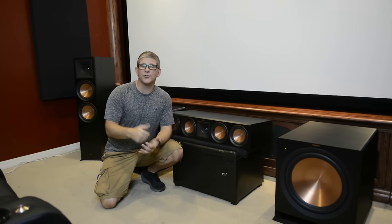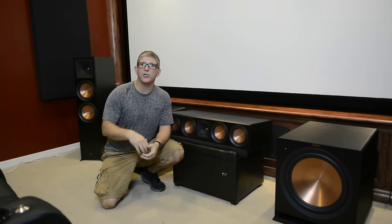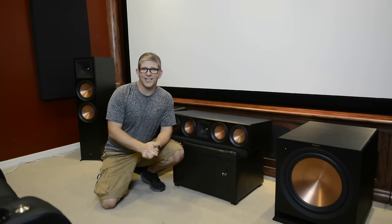One thing I highly recommend is making sure that the tweeter on your center channel is aimed at your ears. A lot of guys will put this on an entertainment center or above their TV, and if you look at the line of sight for the tweeter, it's going to be firing either above or below your ears. I've just got a towel rolled up to lift the speaker so the tweeter is aimed right at my ears. Now that I've got all the speaker wires connected to the receiver, the next step is to run Audyssey — a room correction software that will analyze my room and make corrections via EQ, crossover settings, and so forth. I'm not going to go step-by-step in this video, but I'll post a link in the card above and in the description. I've got all the speakers calibrated using Audyssey, and I also used my SPL meter to make sure each speaker is level-matched, meaning each speaker is playing at the same volume. The only speakers I didn't level match are the subwoofers — Audyssey tends to set those a little too low for my preference, so I always boost those about 5 decibels. Big thanks to Klipsch for making this video possible on the Reference Premiere 7.2.4 system.